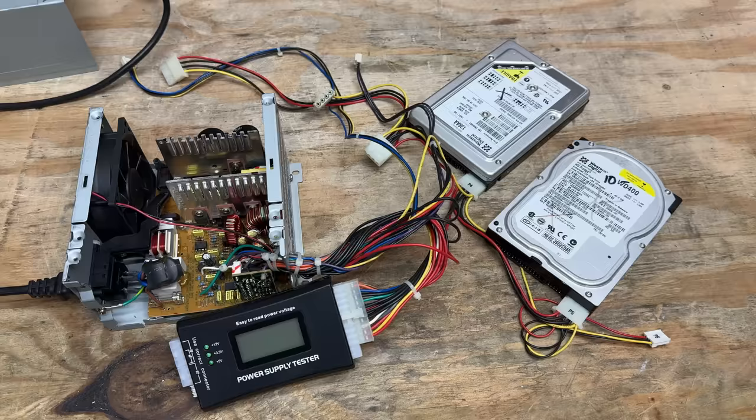It's better - let's get it back on there. Actually I'm going to take it back off because I'm going to grease this entire mechanism. I was just fiddling around in here and I noticed that the motor that actuates the laser lens carriage is awfully tight - it feels almost like that motor is seized. That might be that overheating smell I noticed. By the way, if you're wondering why my voice changed, I seem to have acquired some human malware. I'm going to make a little mark on that motor shaft to tell me whether it's actually rotating - and no, it is not. That motor is seized.